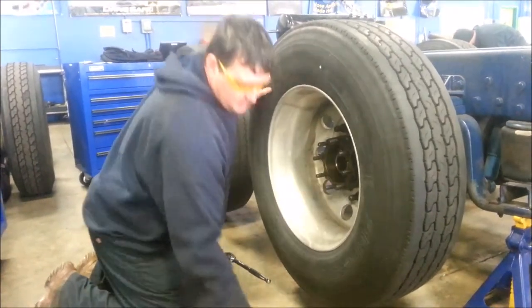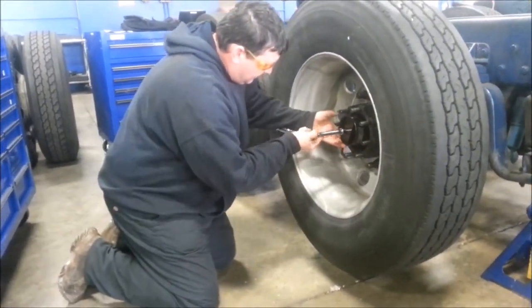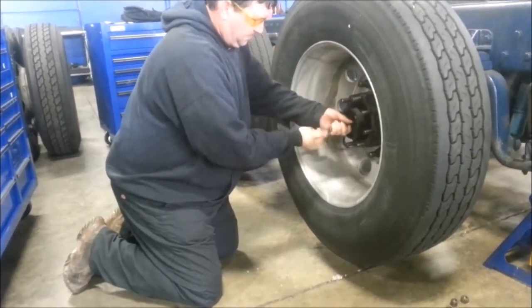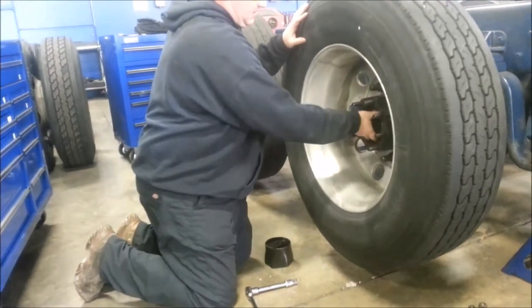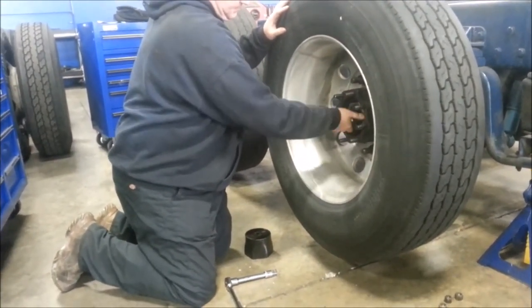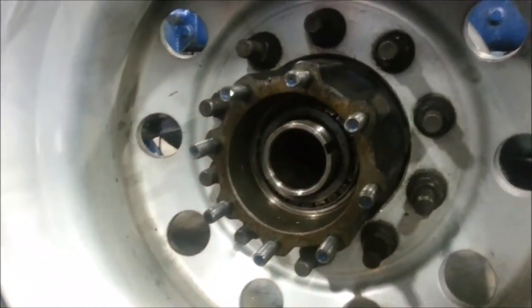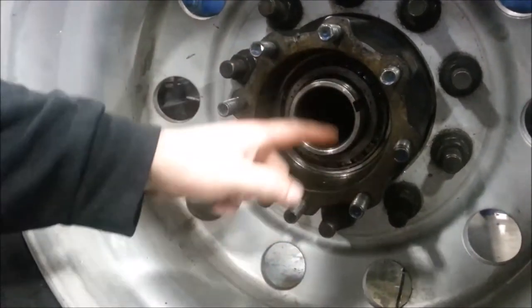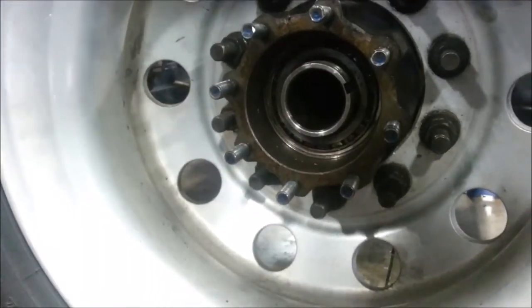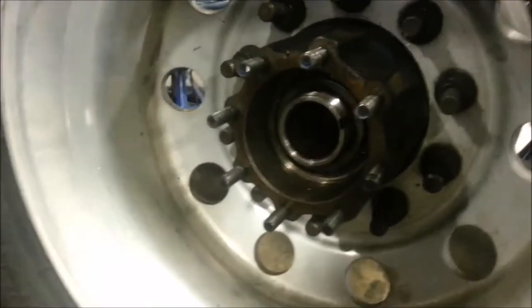There's your jam nut. There are two spacers — I'll explain what those are. I'm going to bring the camera over here. This is your bearing. This is a very important safety note right now: you don't want to touch this tire without any of these lock nuts on here. If you do that, the tire is going to fall forward and come out, catch your finger, and it's going to hurt. This is your main bearing right here, this is the wheel bearing. Your axle goes in here — that's the axle port. So what we're going to do is put this back together.